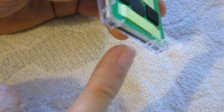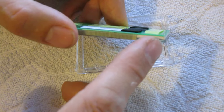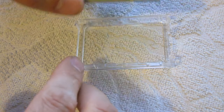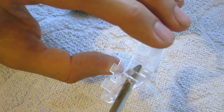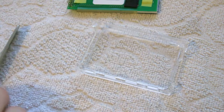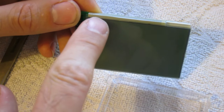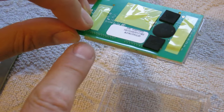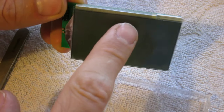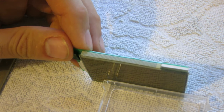Cutting that piece of melted plastic on the back there means that the board is now free to lift out. It couldn't come out the other end because there's a retaining lip on the glass. So the line of the glass here is longer than the PCB, and there's a clear plastic which catches that on a shoulder. Now with the plastic out of the way, we're going to begin inspecting the flexi connector header - it'll be soldered on, pressed on, or glued on. I suspect that's where my problem is.